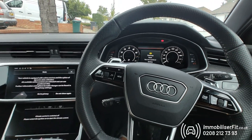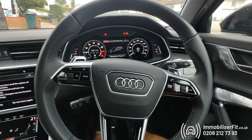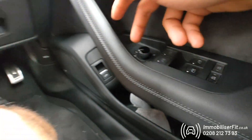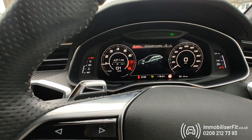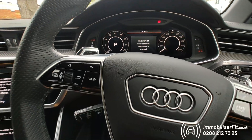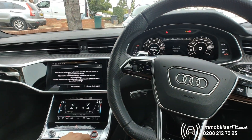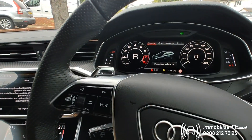They'll be unable to drive it away without passing authorization through the Starline Pro. To demonstrate, we've got a code of one-two-three — which the customer will change — hit the disarm tone, select gear, and the vehicle remains running. You can also pair a phone to the system so the phone can just be in your pocket when you get in, start the car, disarm instantly, select your gear, and drive away with no need to enter a PIN code.